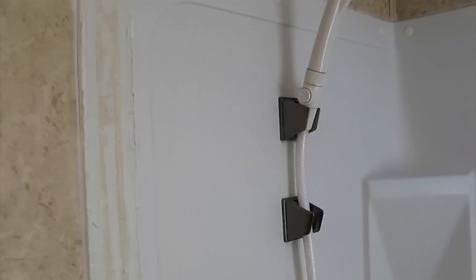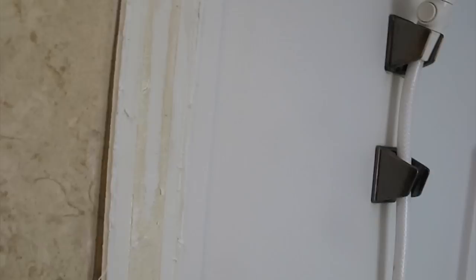My first suggestion is to replace the tub surround at the same time when you replace the tub, because the curtain is attached very securely with some double-sided foam tape and it's very hard to get off. You want to make sure you don't crack it any worse, and it's gonna take a long time to clean up the surround and get it back on securely.